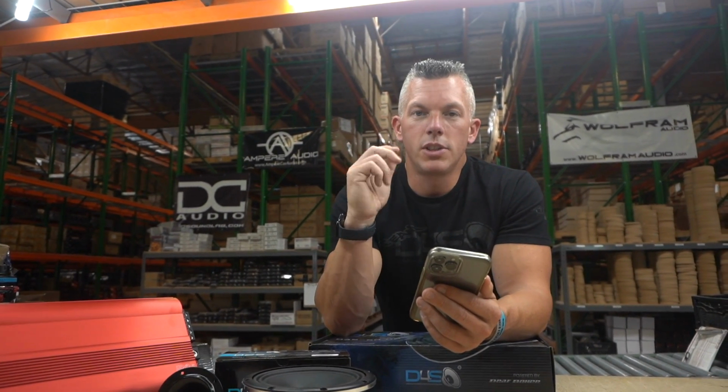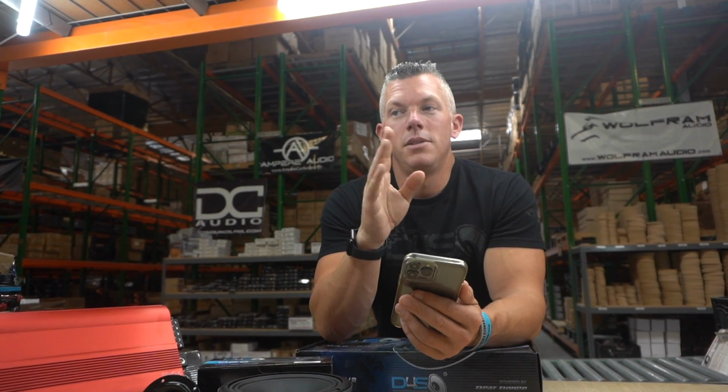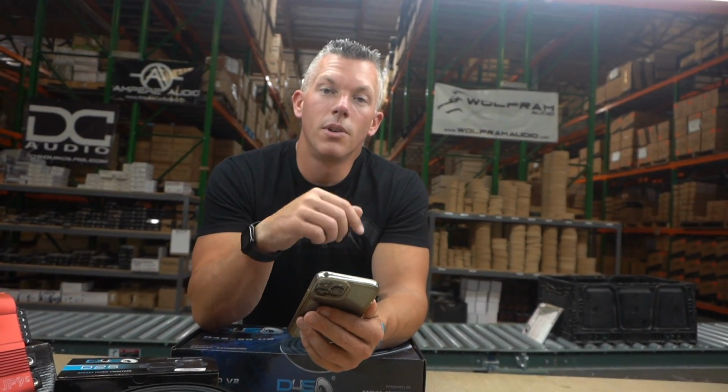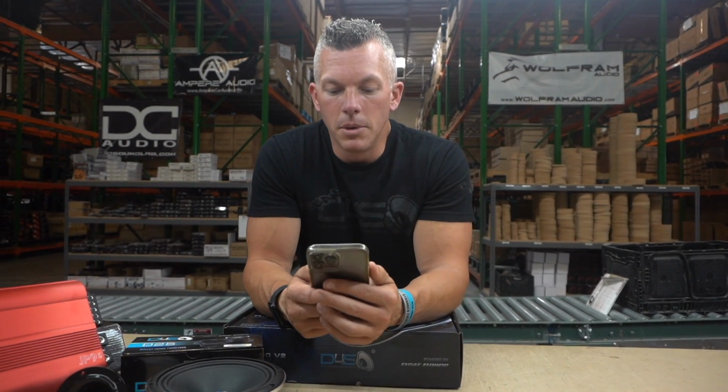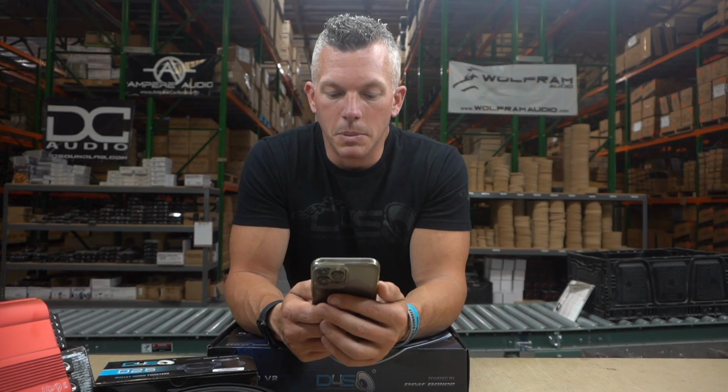And then also, if you go to play your system, like say you take it to a party or whatever, then you just turn the key forward. Well, in this case, you would want to make sure that only the back battery is playing, so that way if the back battery goes dead, you could turn your key forward and it would hook the batteries together, and it would kind of boost your car off, and you'd be able to go home instead of being stranded there. So two different ways there, but me personally, I probably wouldn't. I would just hook them together.